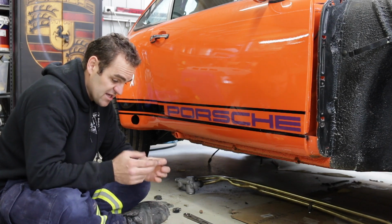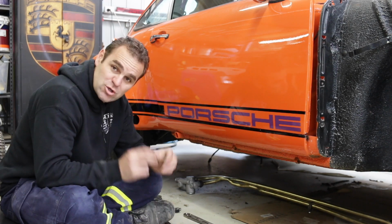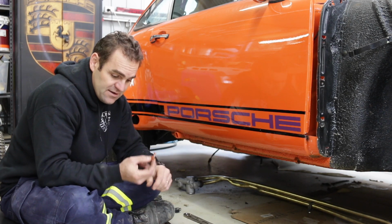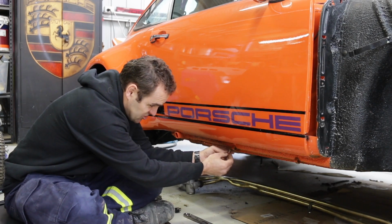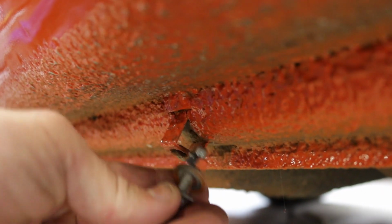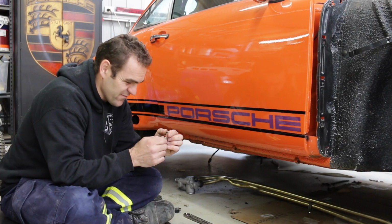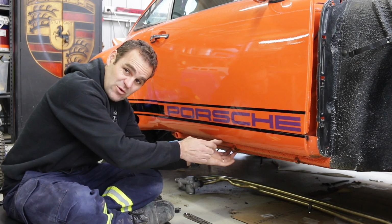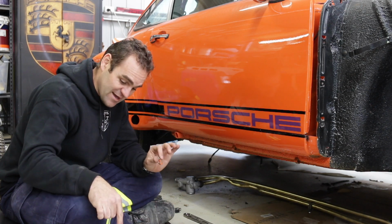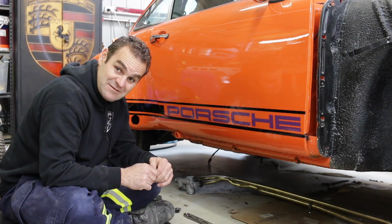So now I need to actually get it all set up and clamped. The other issue I had is I'm not sure how they're actually supposed to be attached to this. What I had on here was a nut and bolt, and a nut was just sitting inside these little U-shaped brackets, done up from the bottom. The trouble is that you can't get anything in there to hold onto the nut, so it makes it very difficult to do up and undo, particularly when I've got oil lines and stuff in the way. There's no way I'm going to be able to get in there. So my thought is to go back to my tried and true favourite rivnuts and use them in there, so then I can just bolt through the whole thing, and we're done.